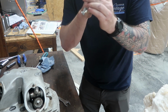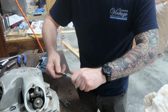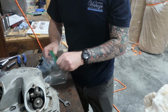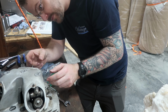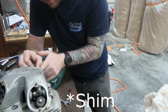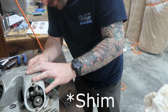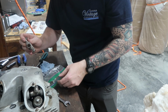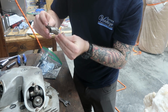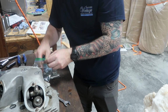Let's keep the bolt screwed in to the spindle, knock it down, and then unscrew it there. So this was my left intake side. So I'll put it in my LI bag. And I'm going to try to remove this. See if I can't grab that spacer. I don't know if I'll be able to. I read that it's best to replace the spacer in these little springs or whatever. So I'll probably go ahead and order new spacers and springs, but these adjusters are not worn out at all. Those bits aren't worn out at all. Inside looks good. So this looks really good.